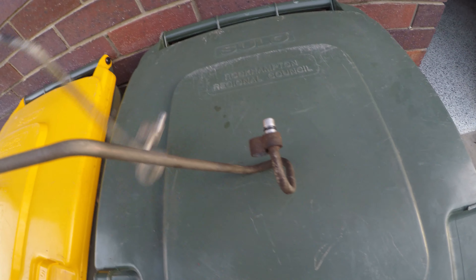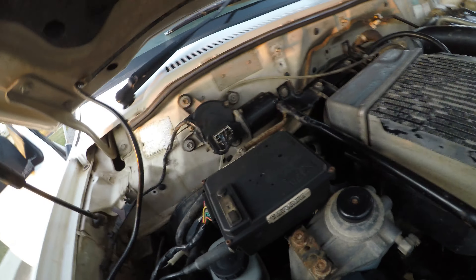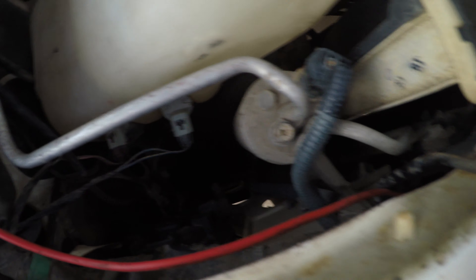What are the seals like? Because I actually didn't get any new seals. That's the old one - she'll be right if not, my mate's got some new seals. A fella that does all my aircon re-gassing. The hardest part about all that is you've got to disconnect the whole top mount intercooler off the firewall there. There's a bracket that goes in there, and then there's these two back lines you've got to undo. You sort of just got to massage it out this way, and she comes out. You've just got to yeet this backwards a bit, disconnect it from the front. That really probably took five minutes at most, so I'm just going to throw this new one in.